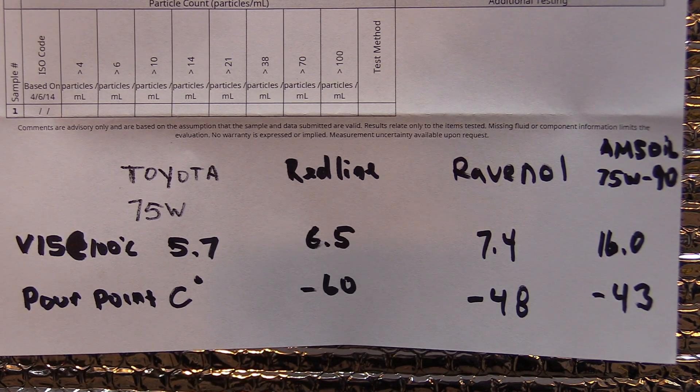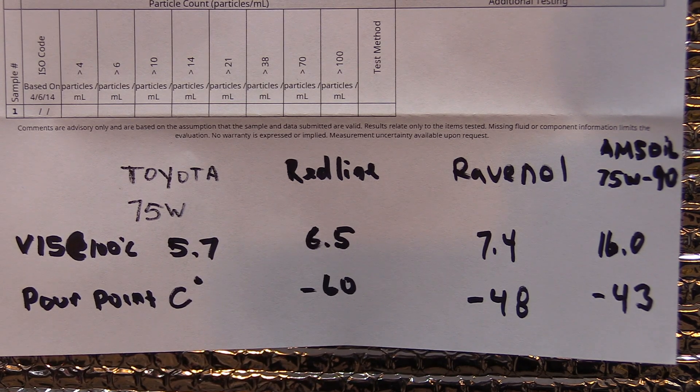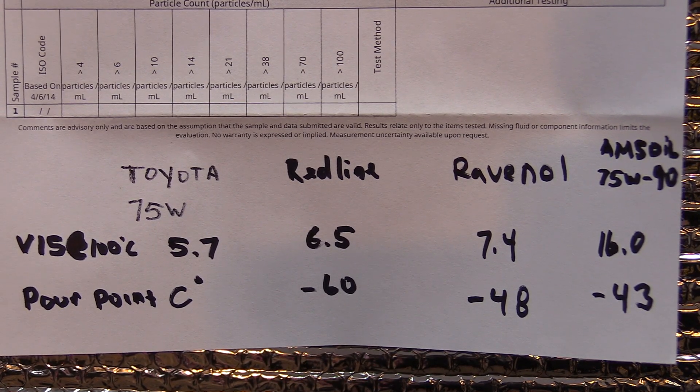How often will the fluid get to 100°C, which is about 212°F? In the summertime it can absolutely get there — around 200°F, no problem. So, is thinner better? If you live somewhere up north where temperatures get really cold, having a thinner fluid for the 2014-and-up transfer case will definitely be beneficial. Because that's what the manufacturer specifies — and I'm not sure if there will be a problem with internal design. I know there is a pump inside the transfer case. Can that pump handle thicker fluid? Is there going to be an issue with lubrication and wear? It's unknown.